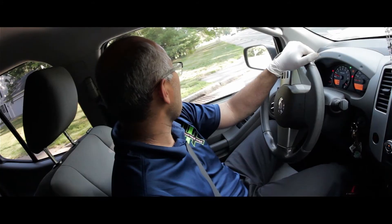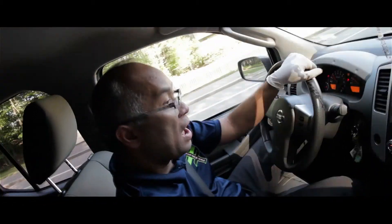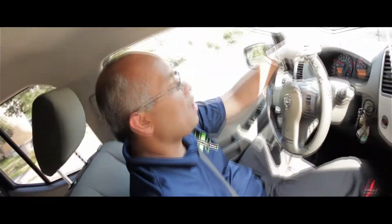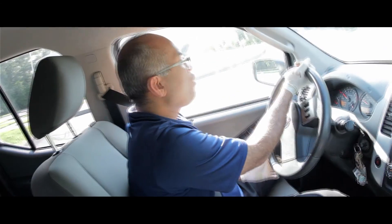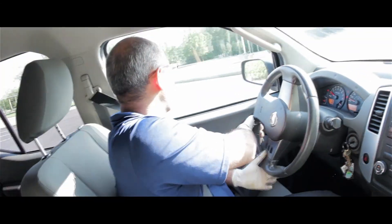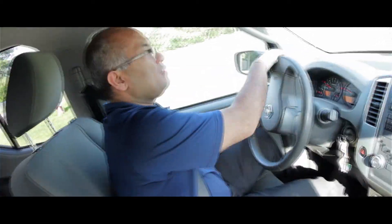Let's go for a test drive. The car is moving — moving is a good sign. Because if that sensor's not working properly, it will shut down and stall — that's why you need a properly working camshaft sensor. So far it's good. Always test drive your car when you finish your work, to make sure customers are safe. This car's good — it's not stalling, it's working properly, and the engine sounds good. We are good to go and give the car back to the customer.